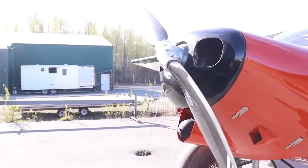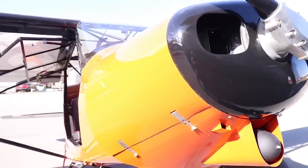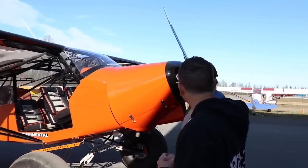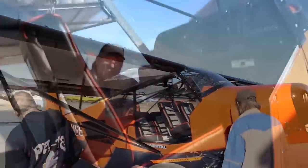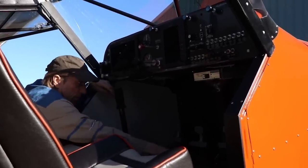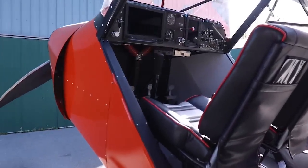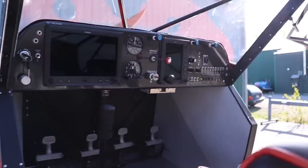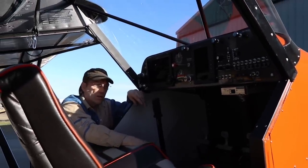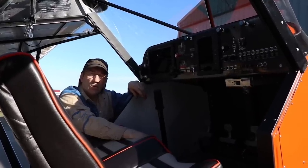So versus a standard certified cub, you've got the wing slightly longer, some changes to the ailerons and flaps, a souped-up engine and prop, and some tweaks on the airframe to support a different door frame. The controls are different too - we put dual sticks in it, moved the flat panel to the center, put in toe brakes for dual controls on both sides, and moved the throttle. The yokes and controls are actually a little bit faster - we shortened some of the linkages.